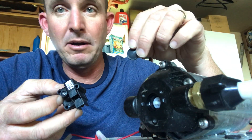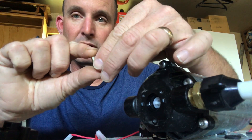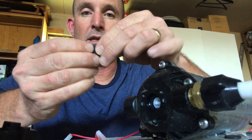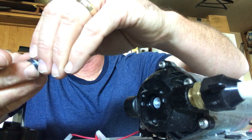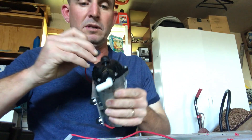The new sensor comes with its own new diaphragm — this one's black — but remember, we're going to put it in the same way the old one came out. The old diaphragm has a plastic insert that goes right on the back side of it. We're going to take the old one out, put the new one on just like that — it just rests on there. The spring goes behind it, and then we'll insert this right where it was before.